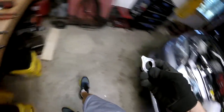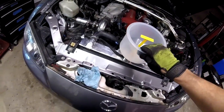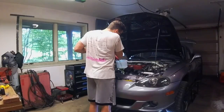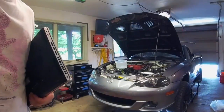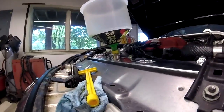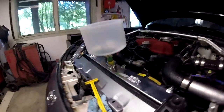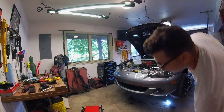Now we're going to set up the funnel bucket. This is the tool I wanted to show you because the bucket comes with all these adapter attachments. The way it works is it goes into the radiator, and then they give you this fake cap. You tighten up the fake cap, and then you just put the bucket on top. This plunger you can put in once you overflow the bucket. Air is bubbling up and out of the system, and it's filling itself back up. Even though the radiator is full, we're getting the air out of the lines, and it will naturally suck it down. I've already got this in a 50/50 mixture — it's all less than a year old from when I did the timing belt and water pump.